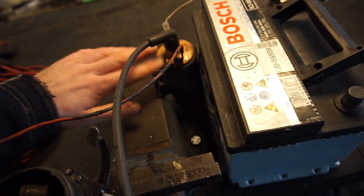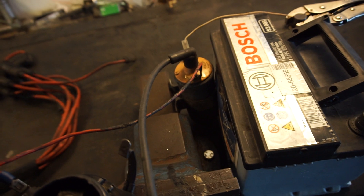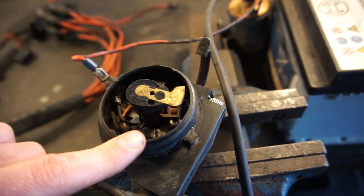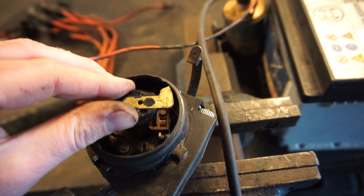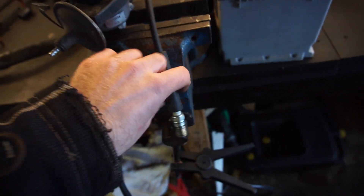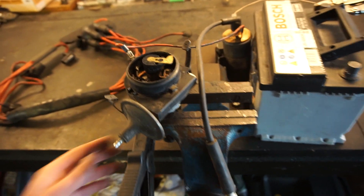So you put the negative on the battery post over there and get 12 volts into the coil. That will create a magnetic field between the primary and the secondary winding, a bit like an electromagnet from school if you remember that. And what happens is when the circuit is broken by the contact points - that's why they're also known as contact breakers, because they break the circuit, they open up. When that happens, all of the stored energy in here gets shot out the middle, so the secondary coil travels down the HT leads through the distributor cap and out to the spark plug, and you get a spark.